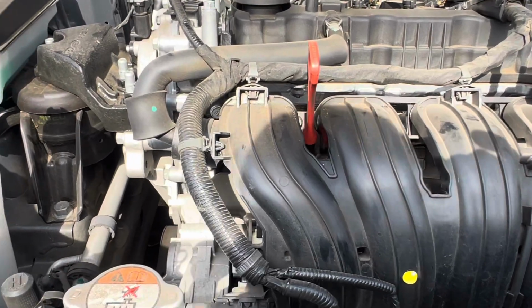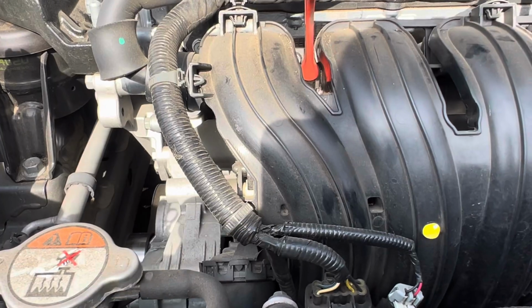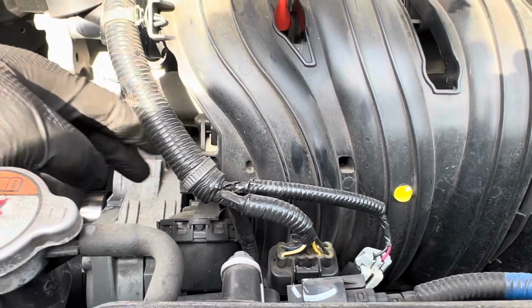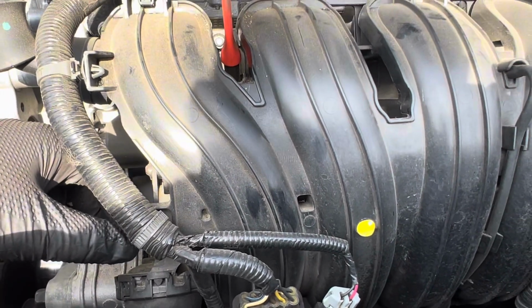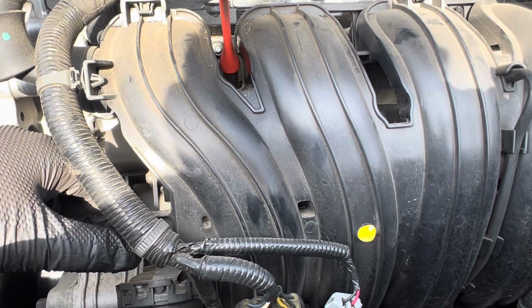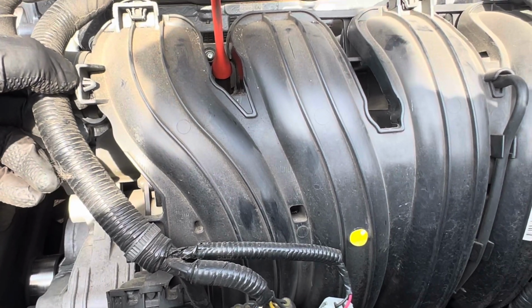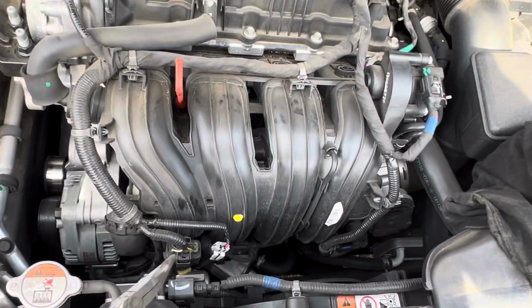And this particular car, I think, has around about 36,000 miles. And before you even ask what killed the starter with that low mileage, I've seen a lot with all these newer style cars is the battery. If you let the battery die and then you try to start it and it does that little clicking thing, that's when you're gonna have issues. So if you know the battery's weak, don't let it get to that point. Go ahead and start making reservations to get you a new battery before it goes any further.